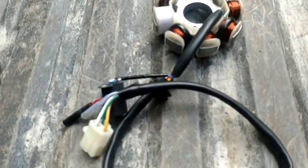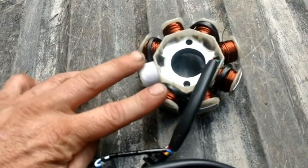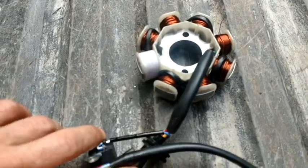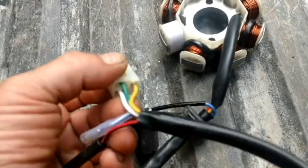A lot of people have electrical questions on Facebook lately. This is your common 8-pole stator. This will fit on a 150 GY6 or a QMB139. The only difference you may have is the 150 may have a square connector, but it still uses the same wires.